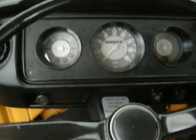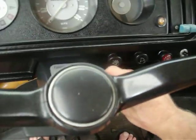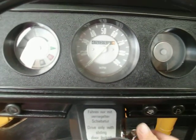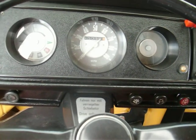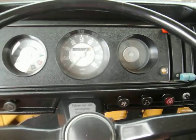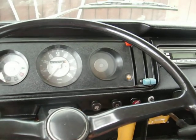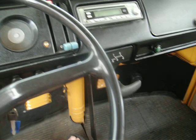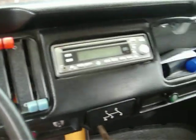I'm just going to hop in the side here and we'll fire it up for a sec. New typical four-speed VW engine — reverse is push in and inside left. Fire it up here. It used to run pretty good. It's got a little bit of popping on deceleration. A little bit more tweaking with the carburetors would probably fix that. It's got a lot of standard VW stuff here.